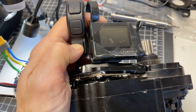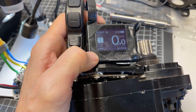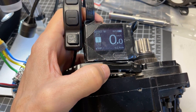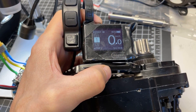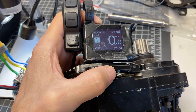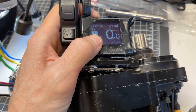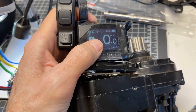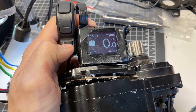Until I shut down the display, the green LED will keep flashing. So if you release it and the green LED stops, maybe you're looking at a problem in the harness or likely the display. Hope that helps.